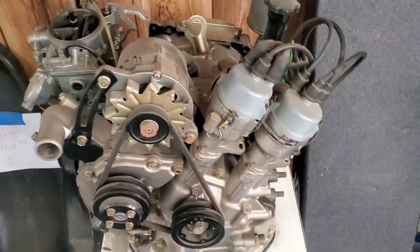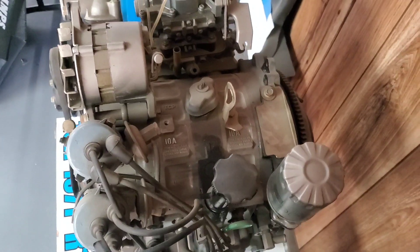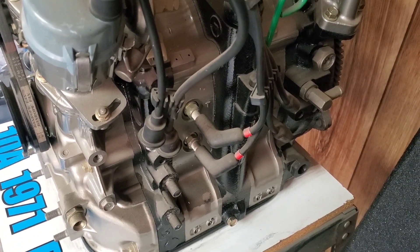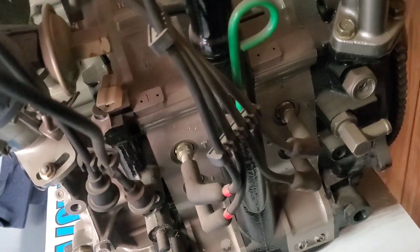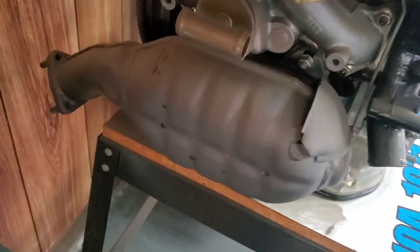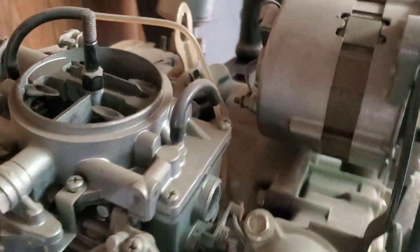If we get down in there, you can see the castings are a little bit thinner. I think Mazda was saving weight or still working everything out. The 10A, like the number suggests, is a 1-liter motor — at least that's what it's based around — with the actual cubic inches coming in slightly under that; I believe it was 982cc or right around that. Typical twin spark plug design, most of your oil and water features, oil flow, oil pump design, and casting indentations are all very similar to what your late 13Bs or even early 13Bs do feature. But the 10A was definitely a unique and short-lived motor.